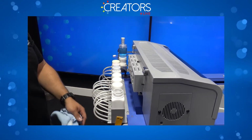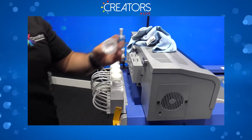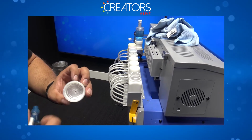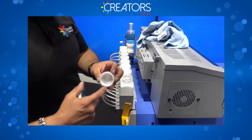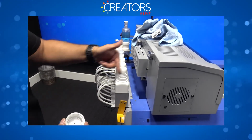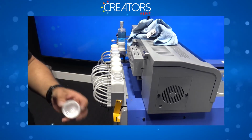All right, so I'm going to remove this. You'll see all that dried ink that we have on the inside part of this cup. You don't want that. The reason why is because if you leave it like that, you're going to put it back, and some of these dry pieces might end up landing inside of your ink. Then when you prime the lines and start printing, those little pieces are going to be sucked through your line, clogging your damper. So be very careful with this.